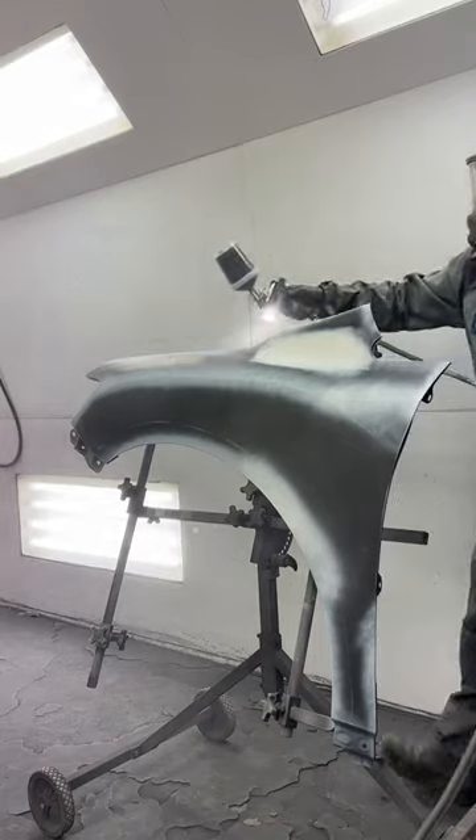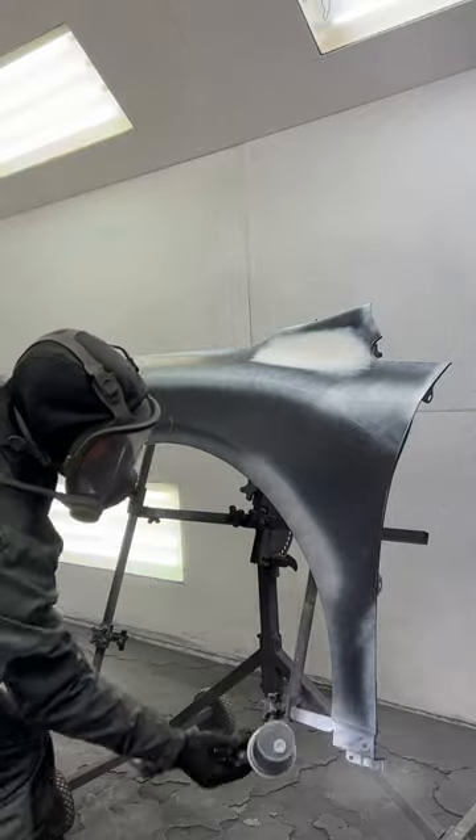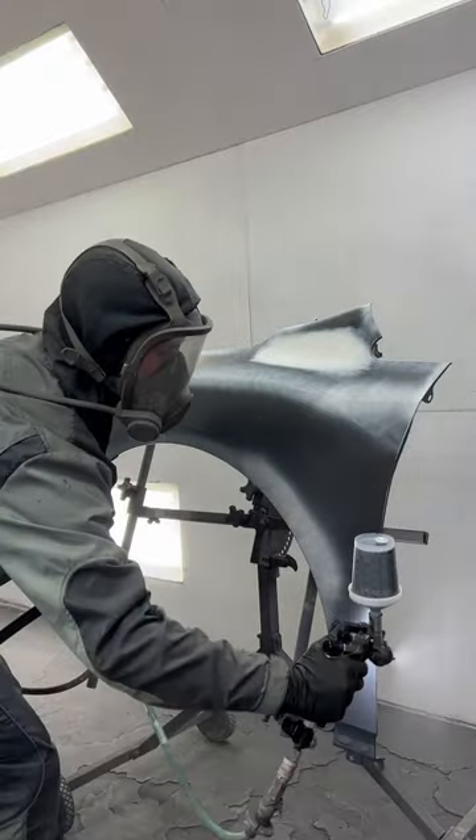And even that spot that's on the fender — I actually primed it with this exact product and then wet sanded with 800 grit to prep the fender to get into the booth.